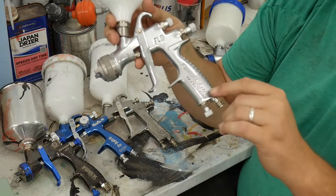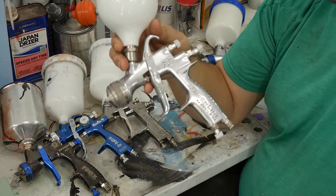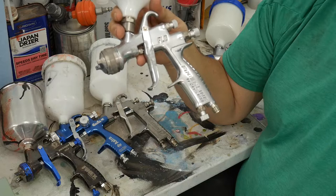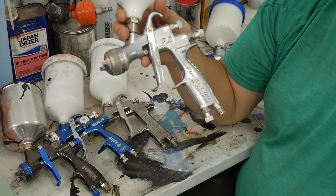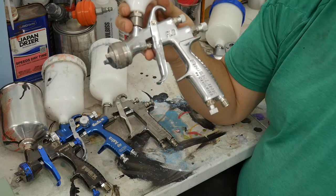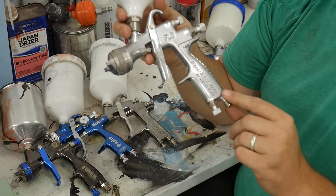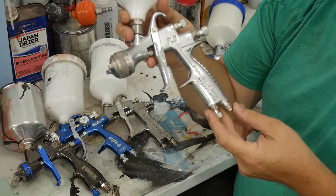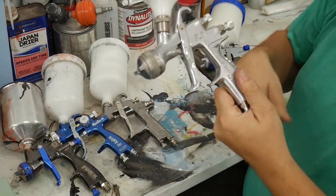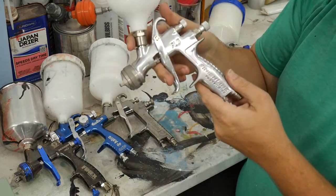It's got a great cup but it's plastic — DeVilbiss is known for their good cups though. The primer gun in the kit has a 1.8 tip, so you'll need to thin ultra-high-solid primers, but with standard high-build primer you won't hit that limitation. The paint gun has a 1.4 tip and looks great on clear — it's a very versatile, professional gun. If you're in a professional body shop situation, you can beat this gun up every day and it will keep performing, lasting years and years.